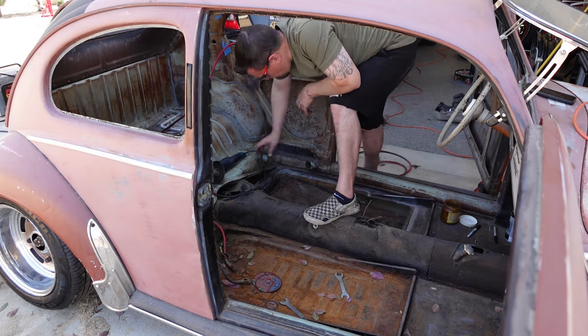We'll just wet sand this. I'm going to do 400-500-600 grit wet sand, then shoot it with the color. And then I'll scuff it in areas to give it its patina look. And then I'll show you what top coat will do, whether we'll clear it or whatever we end up doing to kind of seal it. So that'll be the next episode on that.